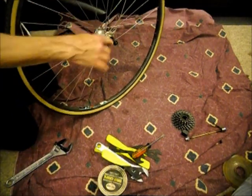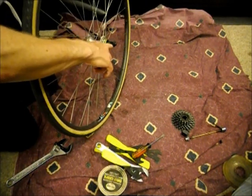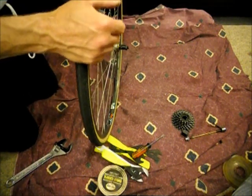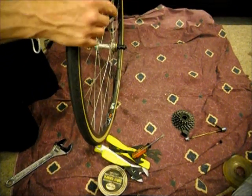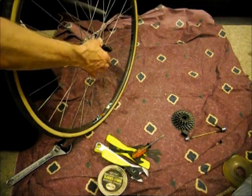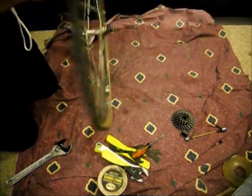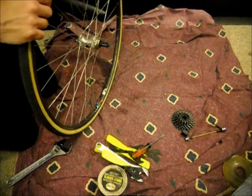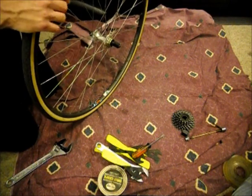now you've got the whole axle part exposed. One thing you'll notice is the rear wheel is not symmetrical — the front wheel is going to be symmetrical. You're going to have even spacers like a cone and a lock nut on each side. On the rear wheel, you'll have some spacers, so you want to remember which spacers went on which side. You'll have more spacers on the side where the freewheel was because it has to extend out farther. One thing you want to look at is how far the axle extends out past the lock nut — get a rough idea so that when you put it back on, you can start the first side with that much gap.